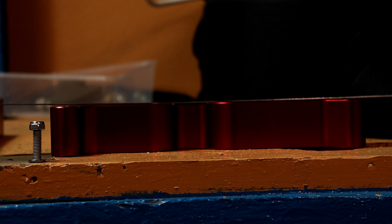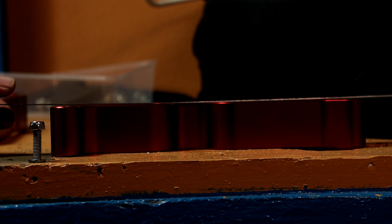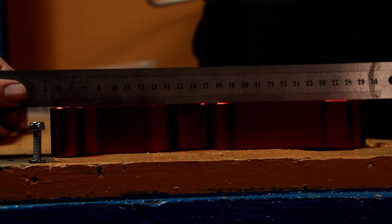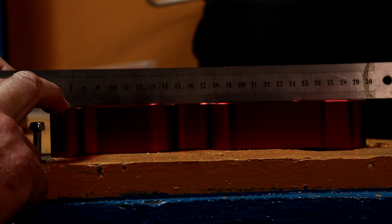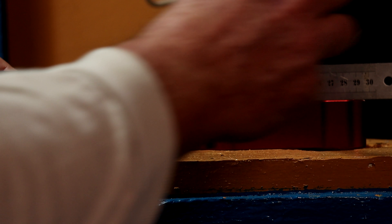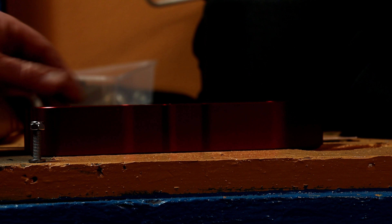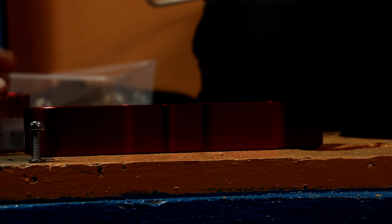One of the other checks I want to do — I'm only going to do a bit of a demonstration here because I've got to get around the camera and tripod — is laying a straight edge. I know it's not an engineered straight edge, it is a 30 centimetre steel rule, but it's the best I can do and good enough for this application. What I'm looking for is rock. We also have a set of feeler gauges and I'll be placing them to see how much, if any, clearance there is. Both sides are mating surfaces — this side to the cylinder head, the other side to the inlet manifold.